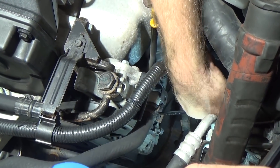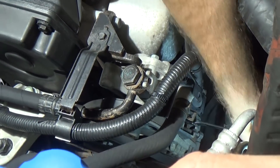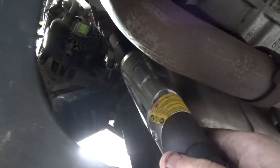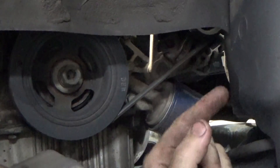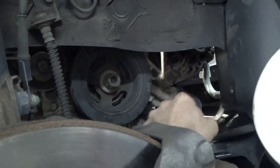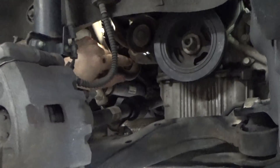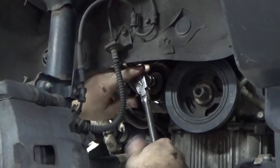The back side bolt is a 12 millimeter as well. Now if we come down to the lower back side of the alternator, you'll see there's a 12 millimeter retaining bolt. We're just going to loosen that nut up. That nut's loose and the tensioner is loose, so I should be able to pull on this belt. Next we're going to loosen up the AC belt.